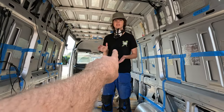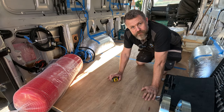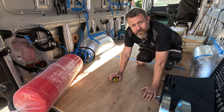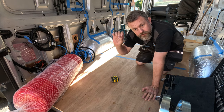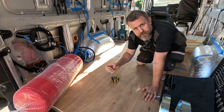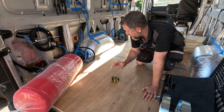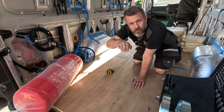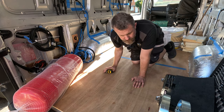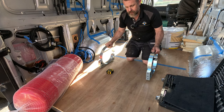Okay, I've got John back to help me because we're going to fit this gas tank underneath. As usual it's not really going smoothly - I thought this would be quite a quick job, four holes four bolts, but of course not. I spent ages reading the instructions and I've now figured out the wires. I've soldered those wires on as a permanent fixed connection because I am not soldering underneath the van on my back. Now I need to figure out the bottom of the van - it's all ridges and bumps so we have to make sure the brackets are either both on a high or both on a low.